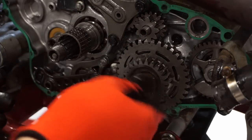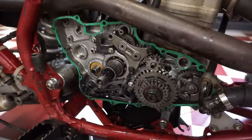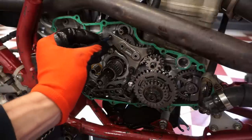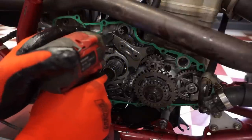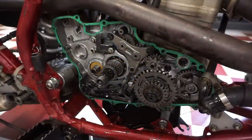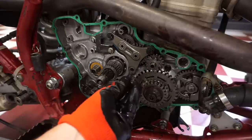Down to 80 foot-pounds. All right, we're gonna put some blue Loctite on the threads right there. We don't wanna put red because we eventually wanna take them back out. So blue, we'll tighten them up, but it'll allow us to take them back out. So let's get that one on. We'll do all of them in blue. Yeah, those were all really loose. Had zero torque on those.